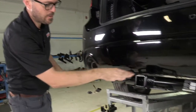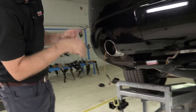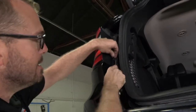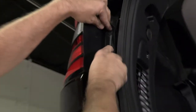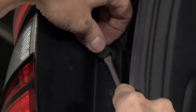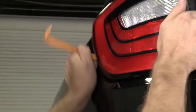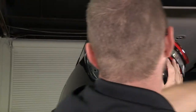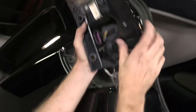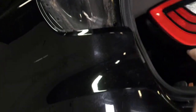Now that I've got that harness run approximately across the rear fascia to this other side, we'll go ahead and remove the driver's side tail lights just as we did the passenger side, removing these two clips first. I'm going to use a little Teflon tool behind the edge of this tail light, simply bringing it straight back, and again unclipping — and we'll set the tail light aside for now.